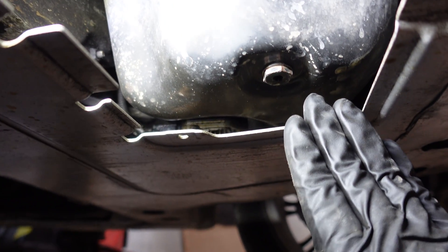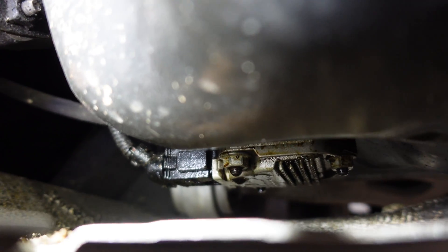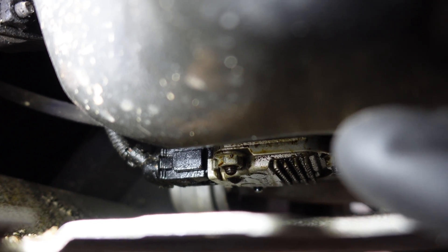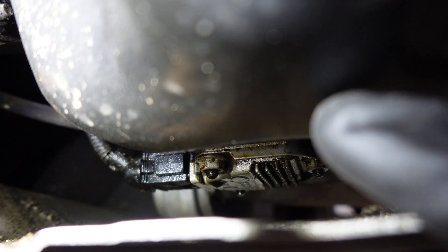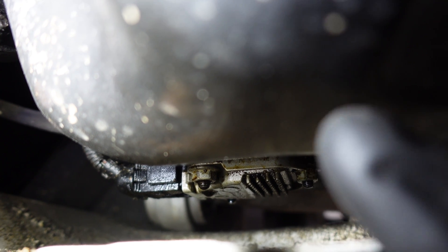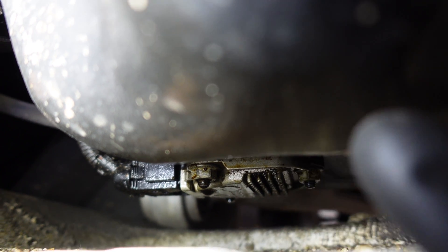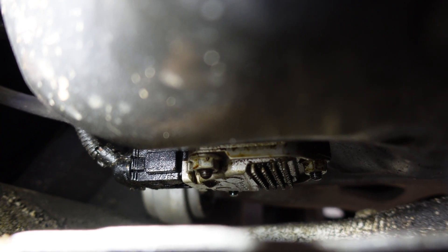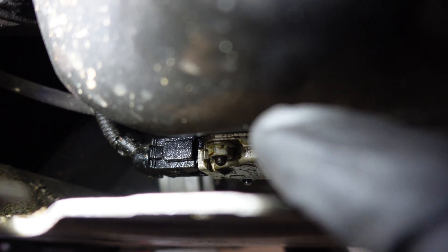I'm now underneath the car. The oil level sensor is located right here underneath this reinforcement plate, and straight away we can see there's a lot of oil down there. One possibility is that the gasket on the sensor itself is bad and leaking. Another option is that we have some other oil leak, and since this is the lowest part of the engine all the oil pools on the sensor and connector — which could be our issue. The first step is to remove this reinforcement plate, clean out the connector, and see if that helps.